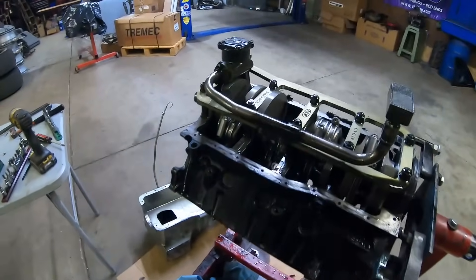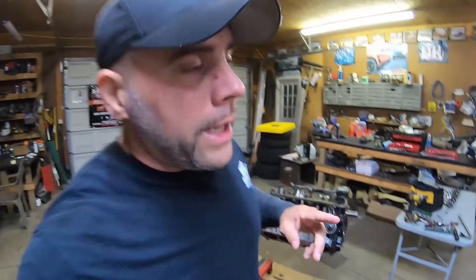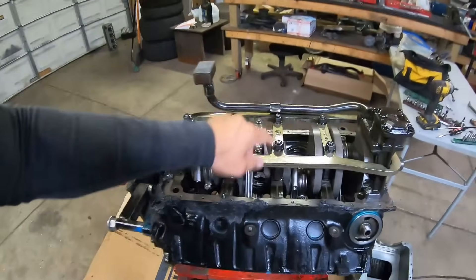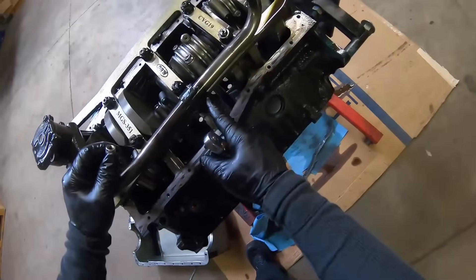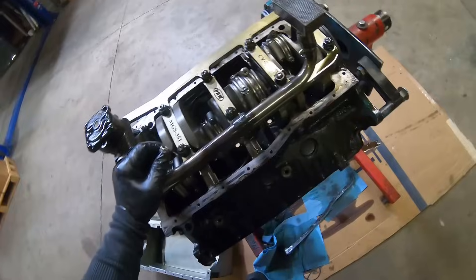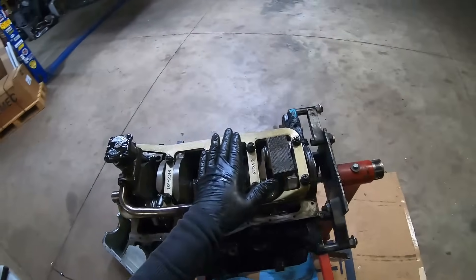I wanted to show you guys - when you're putting this thing together, put a brace on these oil pump pickups. If you've got a symptom with your oil fluctuating quite a bit and you don't really know why in a good motor, it might be a good idea to check to see if there's any cracks around your tab. As you can see here, Dave modified this and created a bracket right here in the main girdle, which kept this nice and sturdy. This is another thing - you want to make sure you have the proper clearance at the bottom of the oil pan.